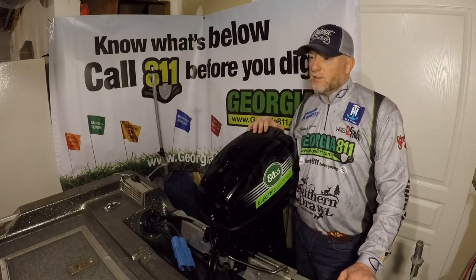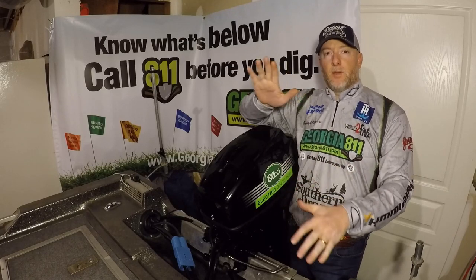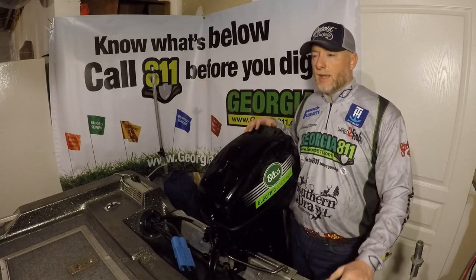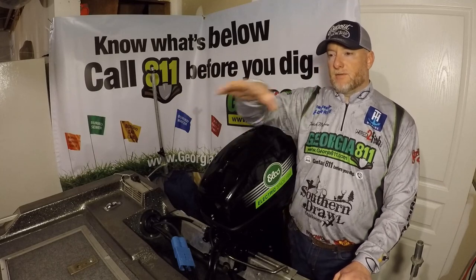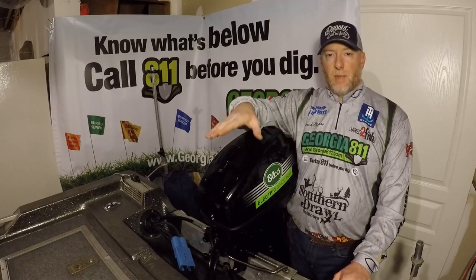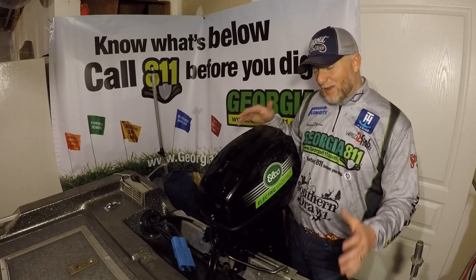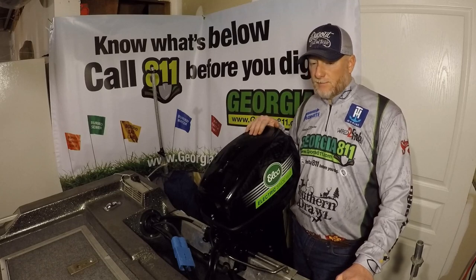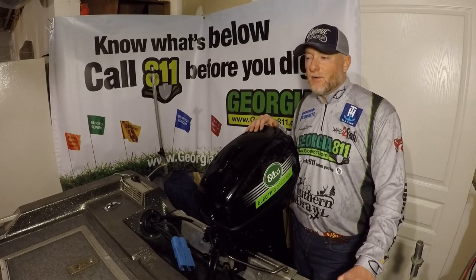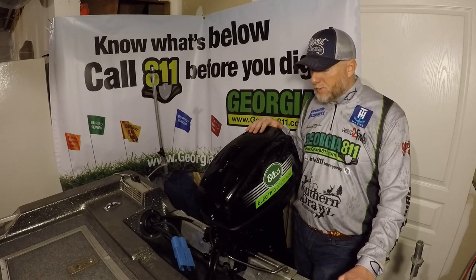to the front of the boat. With an electric-only boat setup, it's not necessarily about trying to get the boat up on plane, because with an EP20 on a boat this size, I'm not going to be able to get it up on plane. It's about figuring out the shift in your weight to the front and balancing everything out to where you maximize your hull speed. So this motor, I'm pushing with the new batteries that I've already showed you earlier, the 4D batteries. I'm hitting around the 7-mile-an-hour range, full throttle with it, so couldn't be happier with this Elco EP20.